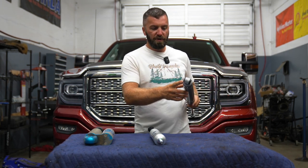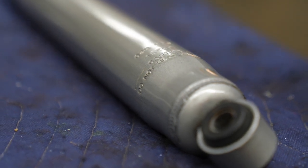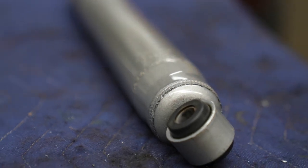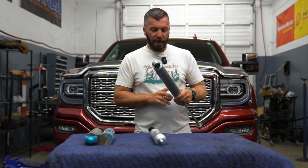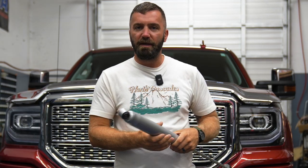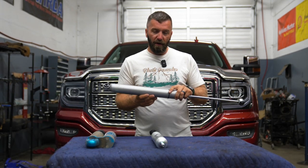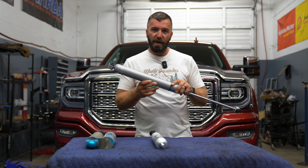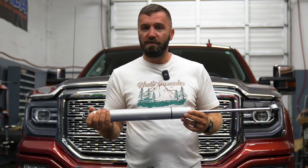You can tell a twin tube because it has this bulge, and what that is, it's a secondary chamber on the outside of an interior chamber. So this piston moves through the shock tube, and both tubes inside move oil independently. They tend to have a softer ride. They typically are much more cost effective than competitor shocks because the design is very easy to machine.